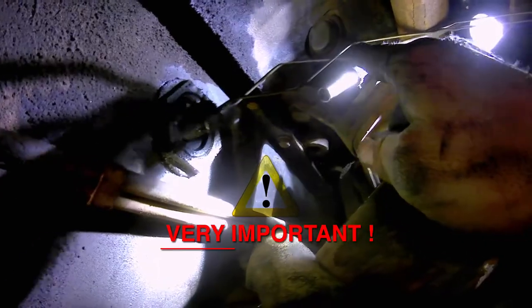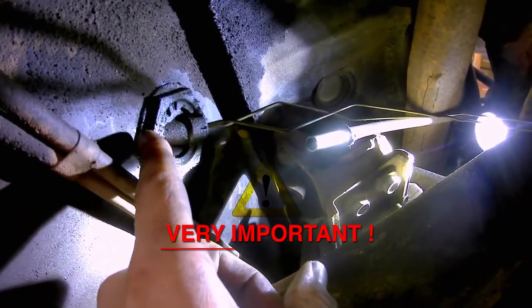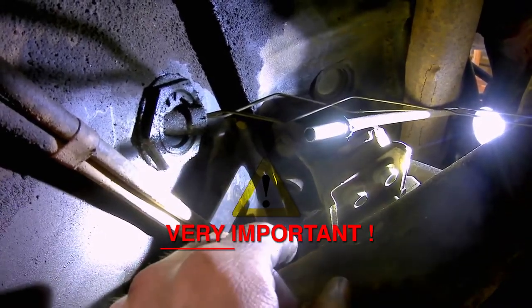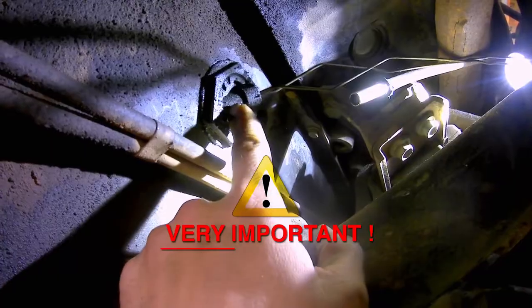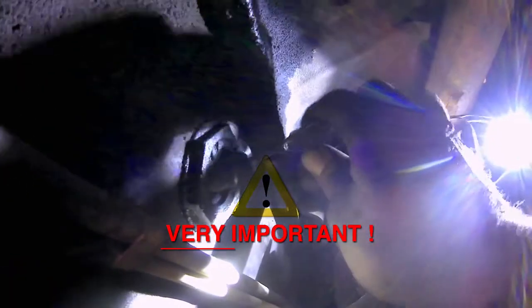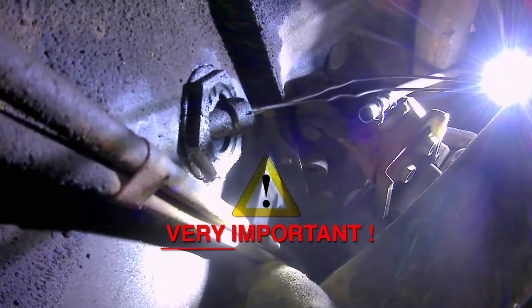As you can now see, the hole is empty. One thing you will want to make note of: I have a tool here that I've made that goes into the hole the dipstick tube came out of. You do not want to take this nut off without holding the adapter with a tool — you do not want it to fall inside the oil pan, because then you'd have to remove the cab and take the engine out of the truck to drop the oil pan and recover the inner piece of the dipstick adapter. The tool I've made goes into that hole with a spring fit, and once it's in, the adapter can no longer fall into the oil pan because you can hold it in place.